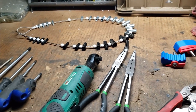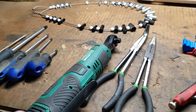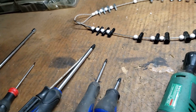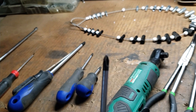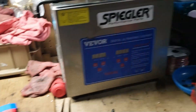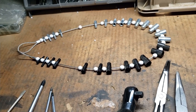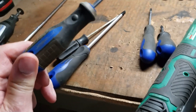This cordless wrench will break bolts loose and holds a good charge — I don't think I've charged it twice and I've done all the complete work on that bike using it. These right here are JIS screwdrivers — they're not your typical Phillips head. The tips are a metric size that fits all the Phillips head screws on that bike, so you've got a fighting chance with a screw that's fighting you. If one of those still won't break loose, that's where the impact wrench comes in. I've got four in the kit but technically only really use these two.